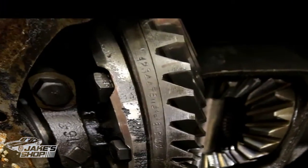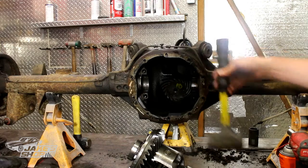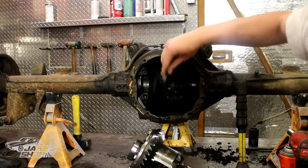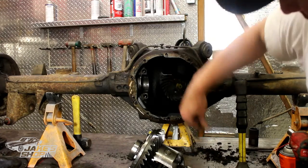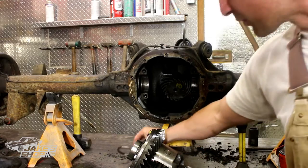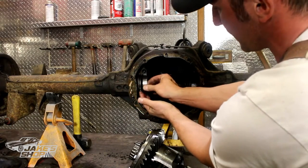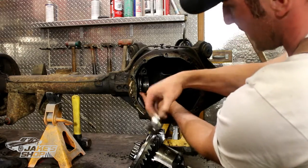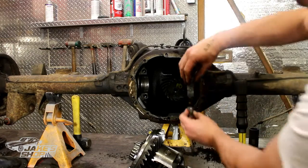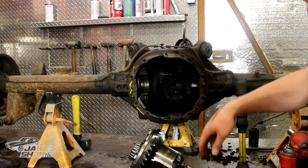I went ahead and got that differential out of there — it wasn't too bad. Gave it a little love tap on a couple of different sides, got the pry bar behind it and it popped right out. This is a really good way to show how this thing is actually put together. This was the shim on one side and this is the shim on the other side. These were machined at the right distance to make all this gearing line up properly. These are the tricky shims — when you go to put this thing back together, you have to stack them up and get them perfect. Here's the race that was in here — it's locating the differential and the gearing from the ring to the pinion. I'm going to keep these bearing caps, mark them with a grease pen — this being the passenger side and the other being the driver side.